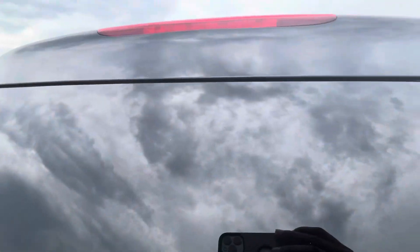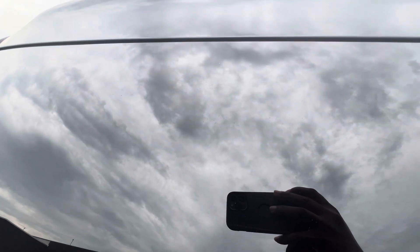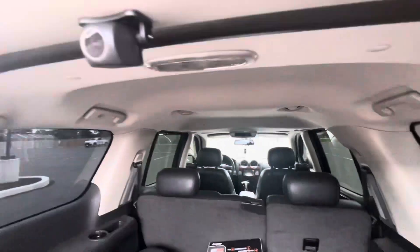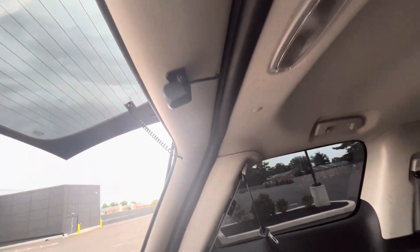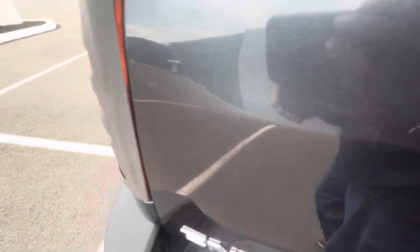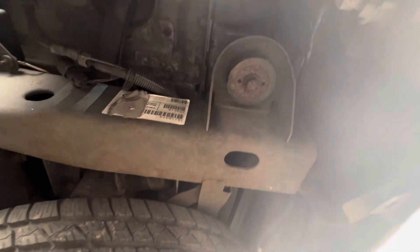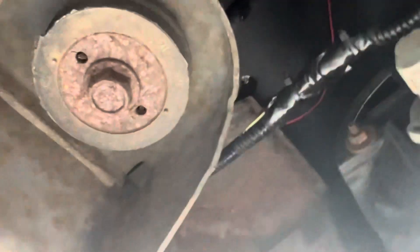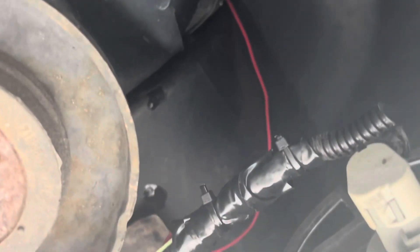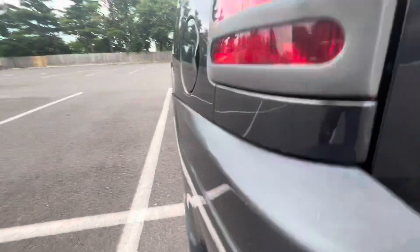Let me show you the camera — it's very intense so you can't even see it in there. There's the camera, through the panel, all the way down the side. The reverse wiring was a little tricky because it's under the truck. I had to literally get under there, tap into the reverse light, tape it up, strap it up, all the way through the floor, through the panel, into the reverse lights.